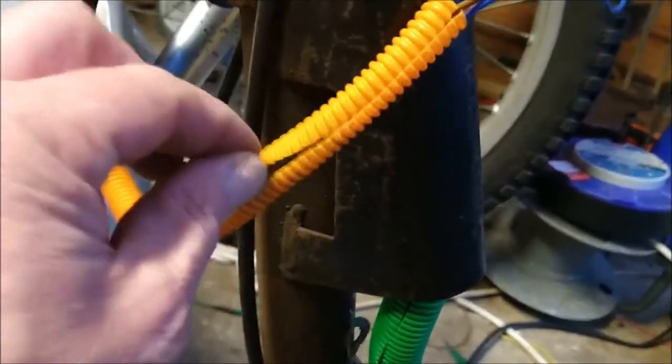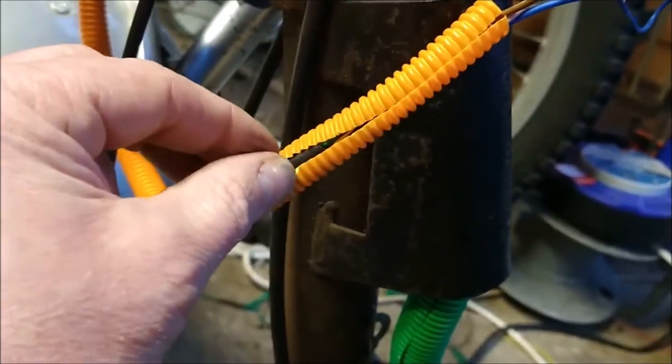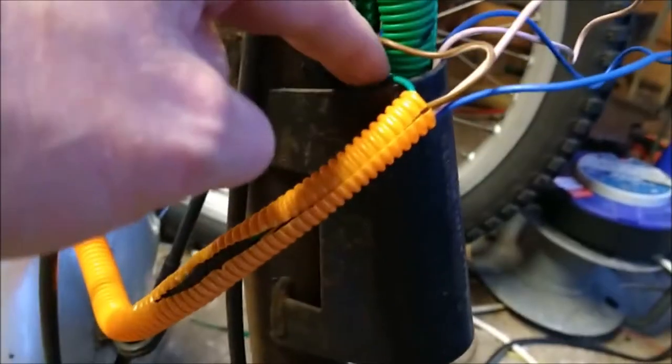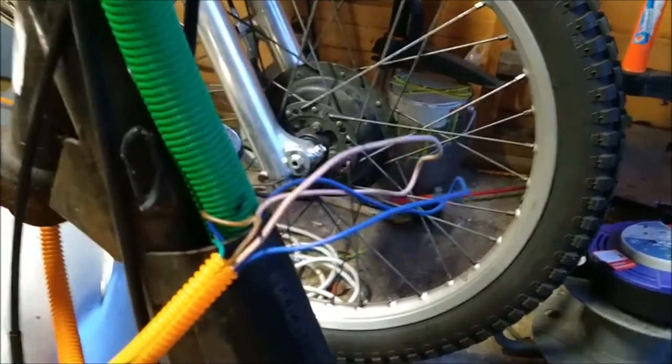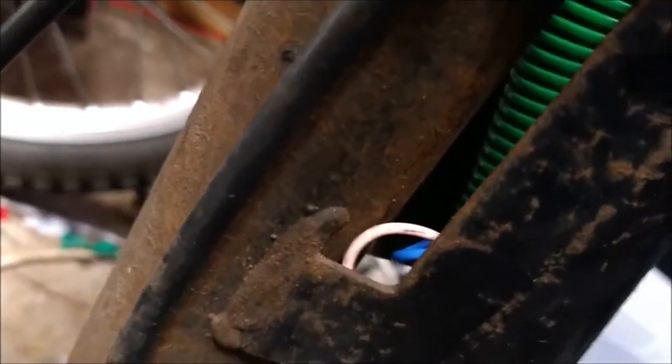I think next time when we go to fully assemble the bike properly I'll cable tie that just to hold it all together as a bunch and then it's going to end up stuffed down that tube. I do think I'm going to have to shorten some of these cables though, otherwise they're going to end up flapping out the bottom. Cables shortened, soldered and tucked in. It's not perfect though because I can still see some down here, so that's something that's going to have to be worked on, but it's not the end of the world yet.